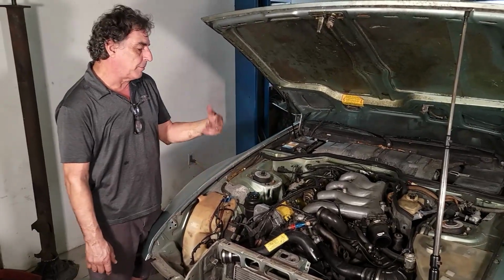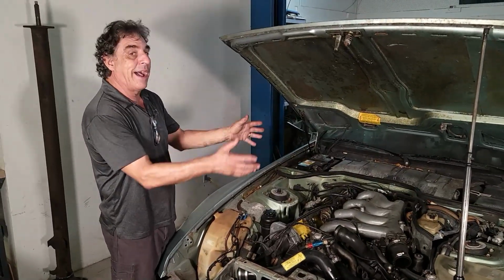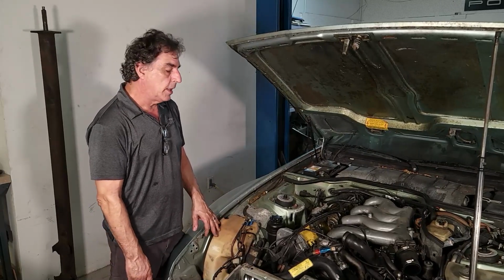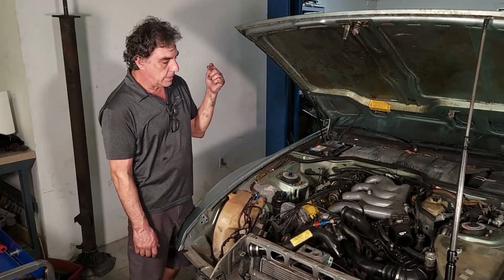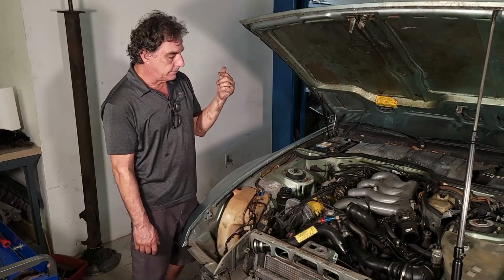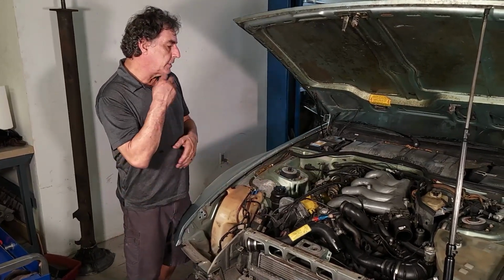We're going to do it anyways to pull the engine. We're going to lighten up the engine the best we can as far as size. You know, get it as small as we can so we can get it out without doing any damage. Sometimes it likes to catch the material, the metal here. And so I want to get the bell housing off and the intake. See what else. We'll pull the distributor, show you all that. So let's get started on the intake.